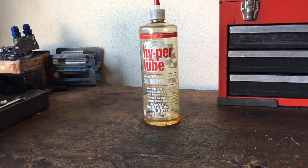Because that's a non-adjustable valve train, anytime you surface the cylinder head, you're supposed to re-shim your buckets so that they're not loud. I don't want to say they tick like a mechanical camshaft, but they're just louder than they're supposed to be. But ever since putting the thing back together, it's had kind of noisy lifter buckets.